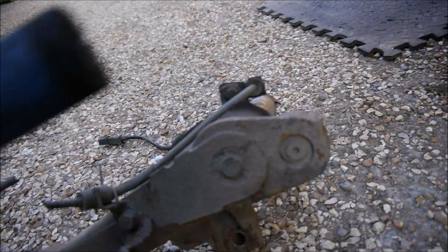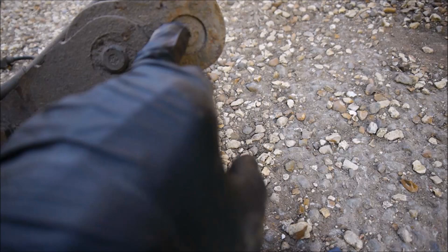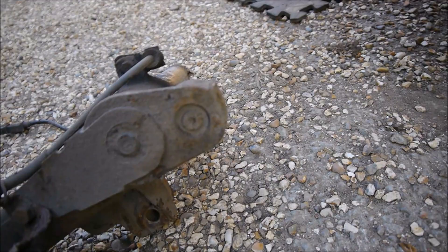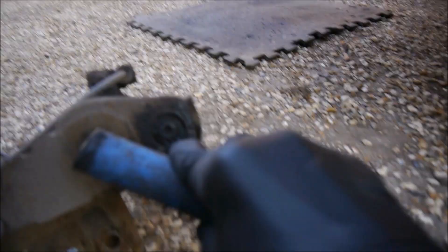This anti-roll bar plate needs to come off — it's 13mm, and the same on both sides. You need to get a good clean in there because the washer inside is a concentric washer that needs to slide across once you've removed the bolt. The bolt in the middle is a plastic bung — I've replaced mine with metal ones. Lots of spraying and rubbing until it's clean. You can be doing this while you take the dampers or shock absorbers off.